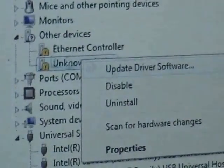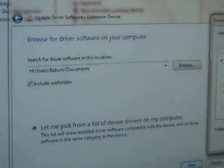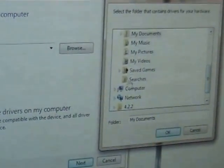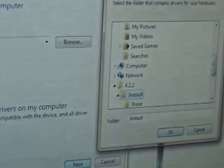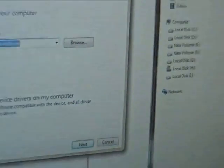Right-click on the unknown device and select 'Update Driver Software,' then choose 'Browse my computer.' Search for the Live Suite you installed — download instructions are in the description. In the Live Suite folder you will see a USB driver folder. Open it and click Next. It will ask you to install the driver — click 'Install this driver software.'